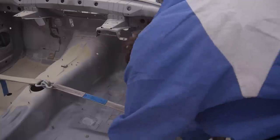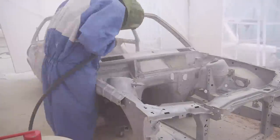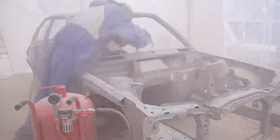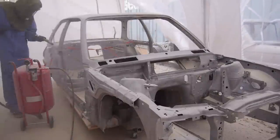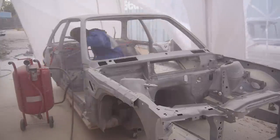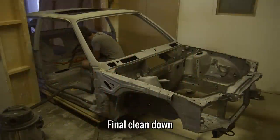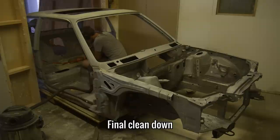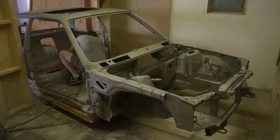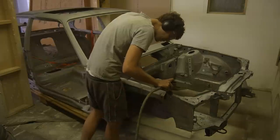After much not so successful research I found out that I need to clean this freshly blasted metal one way or another. There were countless suggestions in the forums dating back from 2008 up to 2022. The general consensus in recent years is to wash the metal down with water and Dawn, or fairy washing up liquid as we say here in the UK, because apparently that strips off all of the residue from blasting and any other contaminants that might compromise the coating. Another more recent method for prepping blasted metal for epoxy primer specifically is to 80 grit it with an orbital sander where you can, and scotch bright the bits where you can't. I'm going to go for a mixture of both, but like a few people on the forums I'm a bit worried about flash rusting, so I'm going to go easy on the water and make sure it's absolutely clean and dry before I paint.